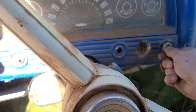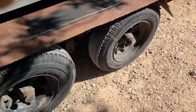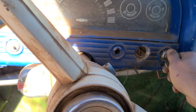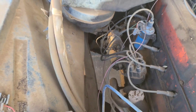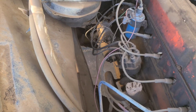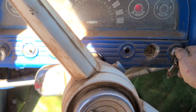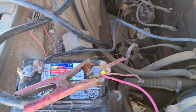I highly doubt she's gonna have any fuel in her. Let's see if she'll turn over at least. Oh, that's not good. Let me go get some jumper cables. I had to fix the connections — they were no good. Round two, let's see if we can get it to turn over. Well, it's acting like a dead battery but it's not — we ain't got no ground. The starter's about to fall out; that could have been the issue we were having with this thing. It cranks real slow but it always started. I kind of cheated and just put the jumper cables on the nose of the starter. She's cranking good now. I think my jumper cables might have fell off — I might just need to get that starter tightened up. I got the starter tightened up.